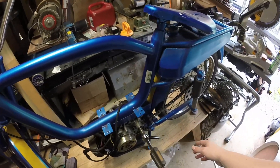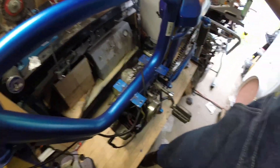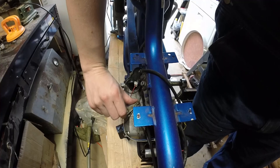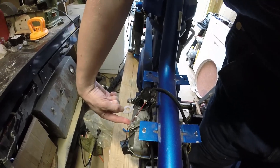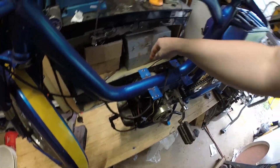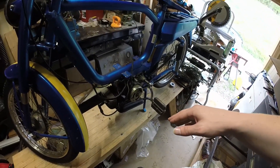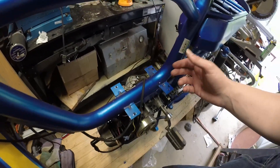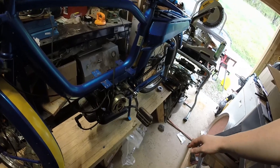So there were a few issues right off the bat. The way this engine works is it has a slip disc clutch — when you pull the starter clutch, it turns a half round that presses a ball bearing actuated starter plate into the clutch to engage it and actually get it to fire. That clutch plate is slipping in this particular moped. It could be the ball bearing and the clutch plate are bad, the wear plates are too short, or they're too slippery and not sticking. So we're going to take a look at that.